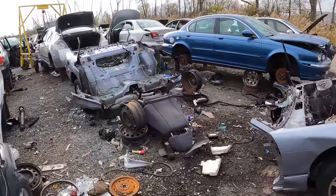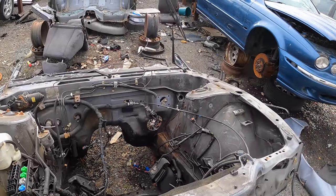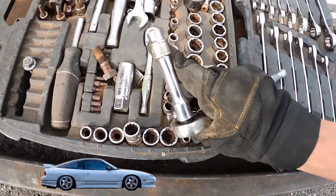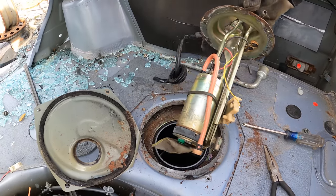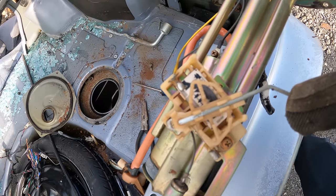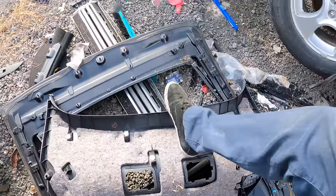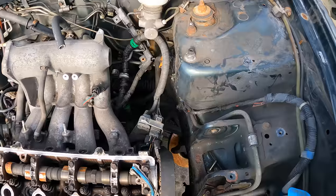What an interesting sight to see — just half of a 240 parked in the middle of the aisle. People went through this thing — they literally took the floor. Since this thing is still here I'm going to take a look at the fuel pump, because these sending units are actually really hard to find and mine actually failed in my car before and it took me months to find one. This is probably one of the best condition fuel sending units I've ever seen. Usually this piece is just rotted out. What really wears out is this circuit board here and the contacts.